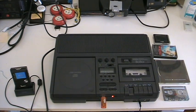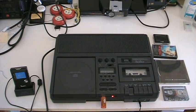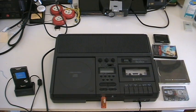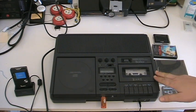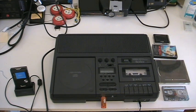We can turn it down and talk about it. You'll notice it's accessing discontinuously. If I do a 20-second clip, it takes about five seconds to process it and turn it into an MP3, build a file system, and put it in there. So we press stop, and as soon as I stop, it just shows lines, and you can see it's accessing the USB. Now we have three songs and two files. That second file will say TP — which means tape because it recorded from the tape — 0001. It creates another file system each time.